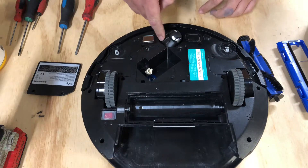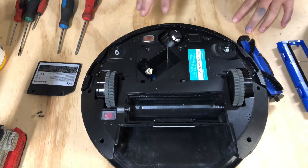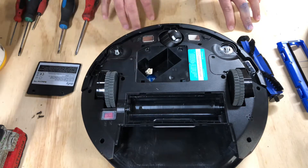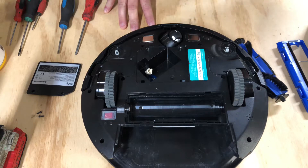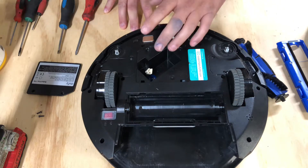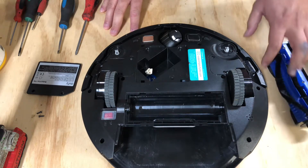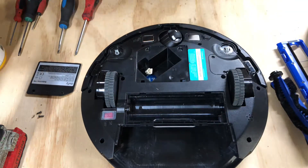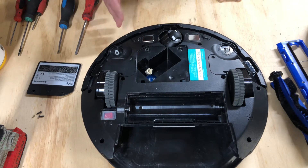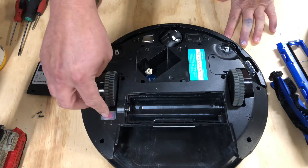You'll take the robot apart to take this plastic piece out — it's not a big deal; I have videos that explain how to remove the wheels, take it apart, and take the bumper guard off. This robot actually has a motherboard issue where it will not charge. Some other preventative maintenance: clean it really well, take the wheels out and get the dirt out, buy a new brush roller, and clean the pads with 91% isopropyl alcohol because that's less water content and it will dry faster. Always turn the robot off — O is off, I is on.